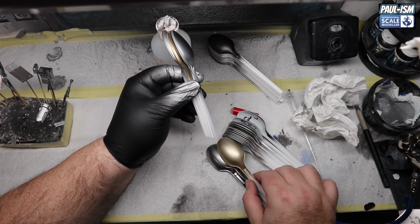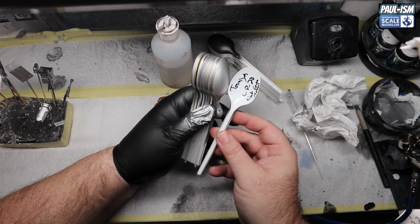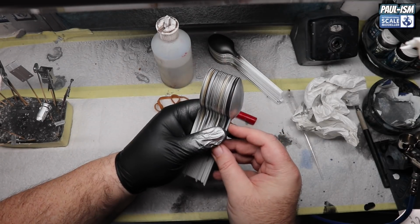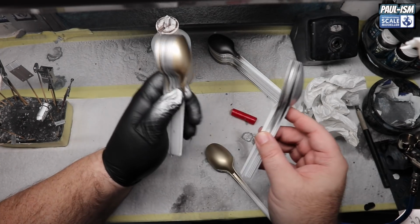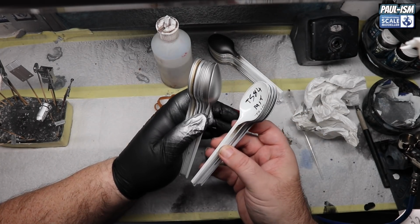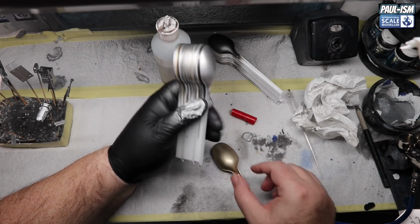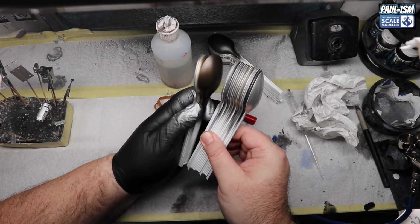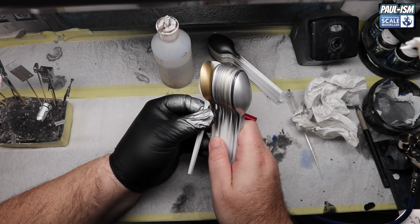Now, looking for colours. A lot of people take the mickey, but spoons pre-sprayed with the colours are the perfect reference. Basically, over the years, as I've sprayed a colour, decanted the paint, test sprayed it, whatever, I spray it on the spoon and keep it. It's written on the other side what it is, how it was thinned. And I can just grab the spoons and have a quick reference.